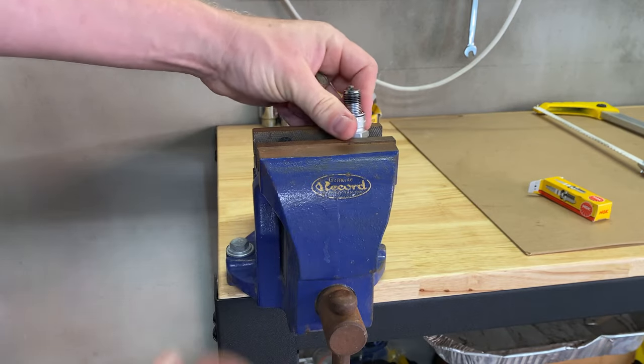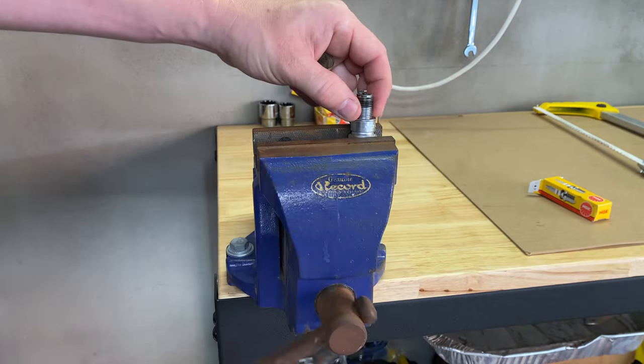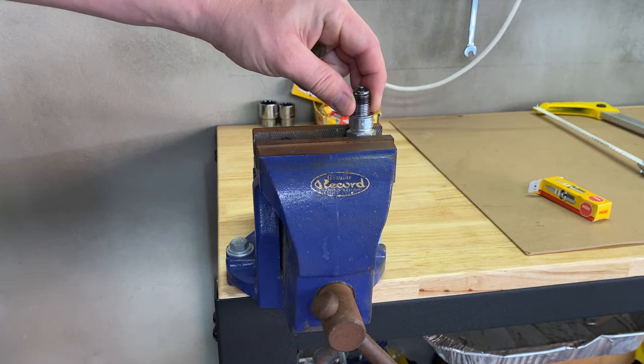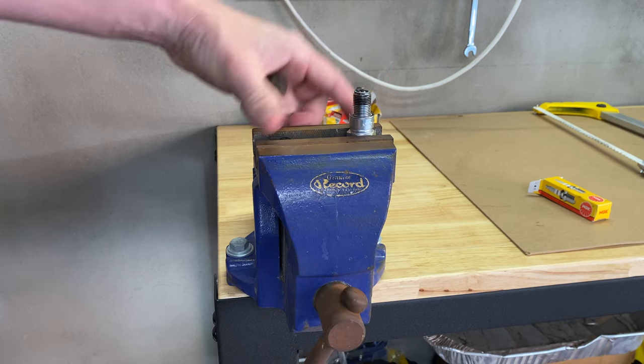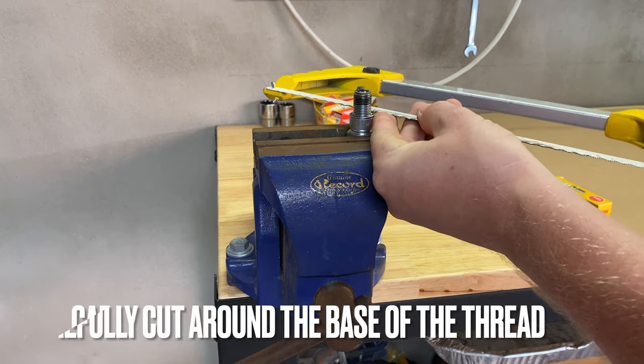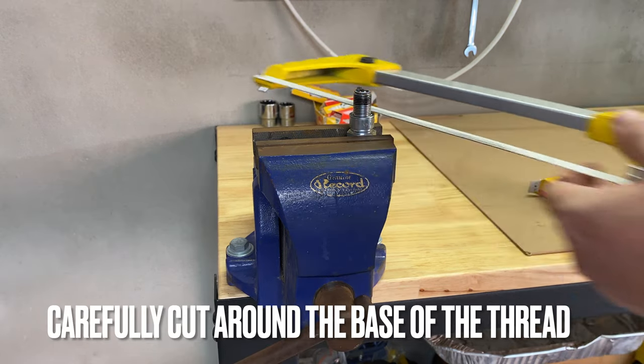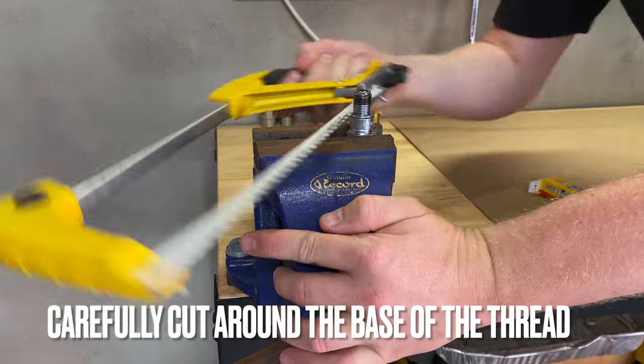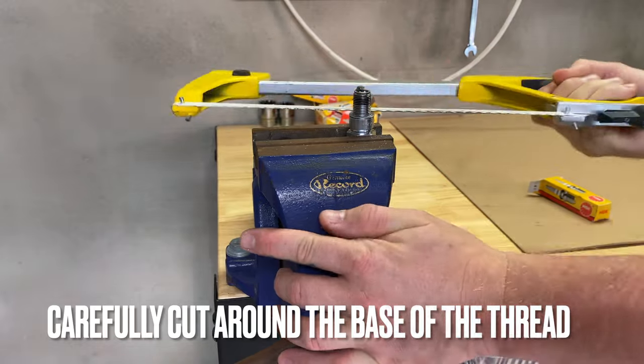I checked the spark plug that is currently in the bike and it's definitely a 9. So all prior tests of the pilot and needle circuit in this video are accurate. This is annoying, however I'm confident that the test results we see here, with all things considered, won't be too much different between an 8 or a 9.